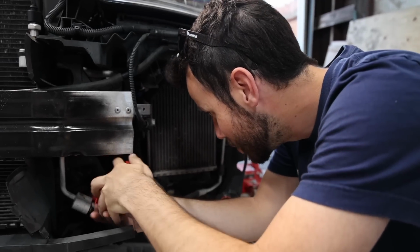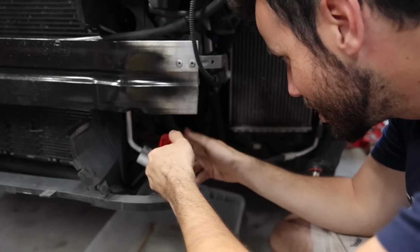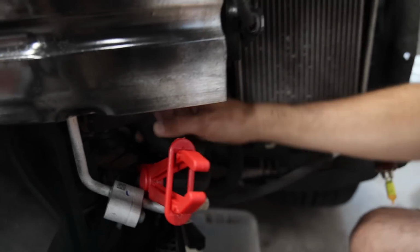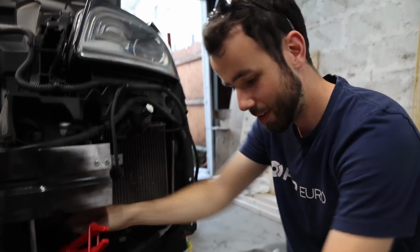So we're just gonna take the coolant hose, probably as close as we can get it over here, and we just slide this out like that. And it should be, in theory, holding the walls of the coolant hose together. It's essentially like your friend pinching it the entire time. I see what you're saying.